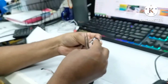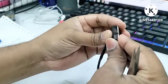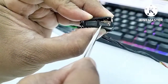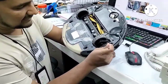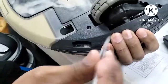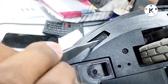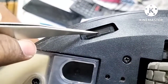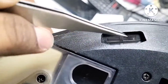Why did this anti-drop sensor become rusty? We can also see from the glass — there is rust visible inside. From here we can confirm whether the anti-drop sensor is okay or not. As you can see, this sensor has rust inside the glass, so this sensor also needs to be replaced. That is why the Deebot is giving the error.